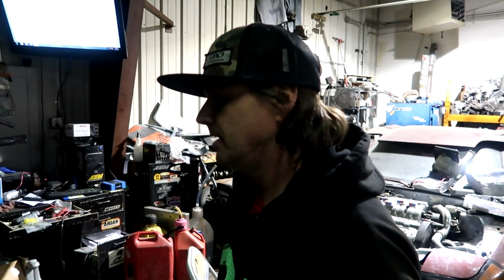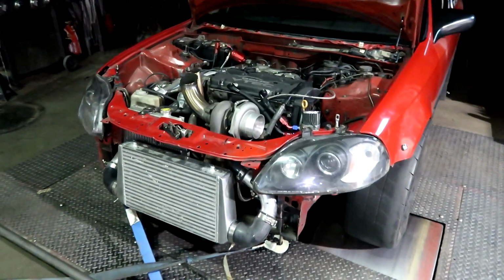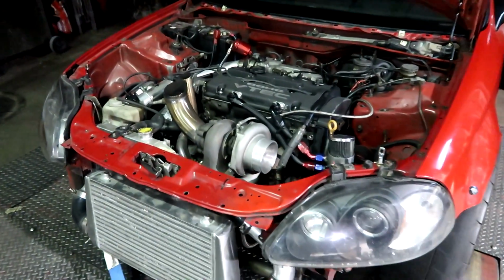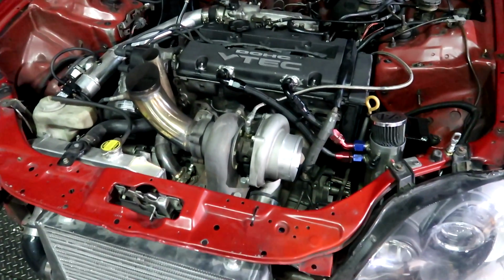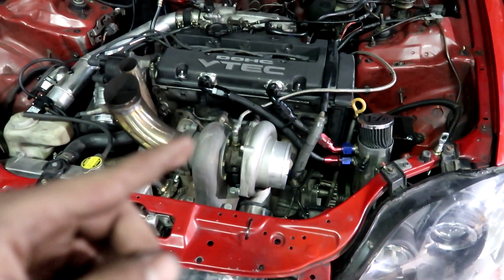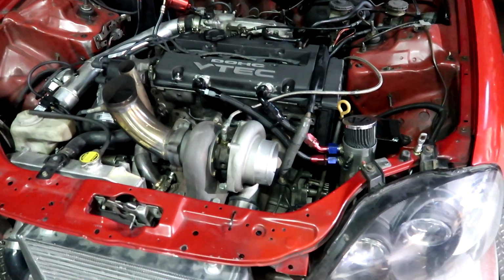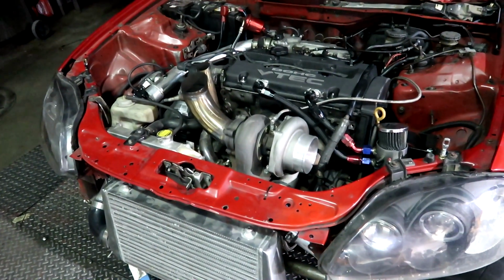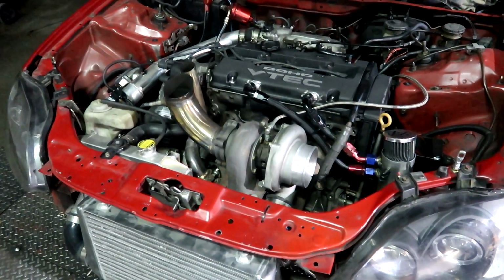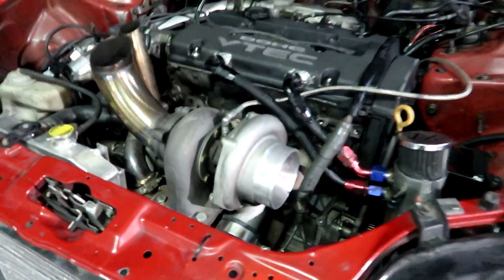That last pull, yeah, something happened. So I don't know what went wrong. I don't know if it's just the turbo itself, because it's an eBay one, but I don't know if something was up with the oil, because I did let Jeremy borrow my 90 fitting and restrictor, and I did just put that on today to get my car running again. So I did just take it off and I looked through it. It didn't look like there was anything in it that was clogging it up. So really not sure, but the turbo did sit open, right?